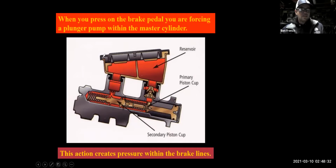So let me redraw these brake seals. Here is the piston, and it's going in the bore, and I'm going to draw this in brown. Here is the little brake seal, and it's a lip seal. So it's designed kind of like this. When you step on it, it kind of flares out and does a better job sealing.